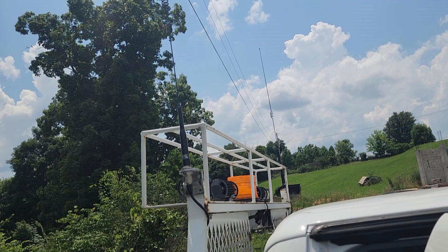A lot of big semis are fiberglass, so there's no metal to create a ground plane off the roof. Josh is the only one in our club running a co-phased arrangement, but for some of you this is old school CB stuff — there's no reason you can't use co-phasing. If you look at beams on some people's towers running two beams, that's co-phasing also. Getting them far enough apart can be an issue just to get the pattern useful — if they're too close together, the pattern's really not much different than a single antenna. I'm KY4BDP Brian for the Lake Cumberland Amateur Radio Association. Hope you enjoy videos like this — maybe it gives you food for thought. Hit that like button and subscribe to see new videos, usually once a week. Take care, everybody, and we'll see you down the road.